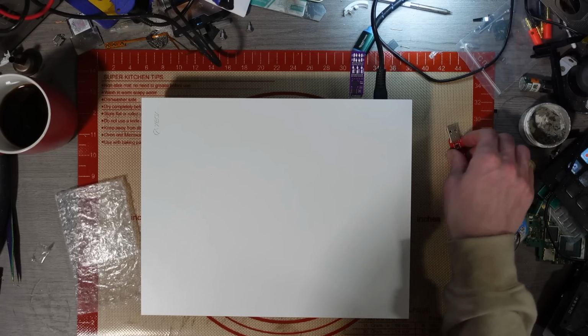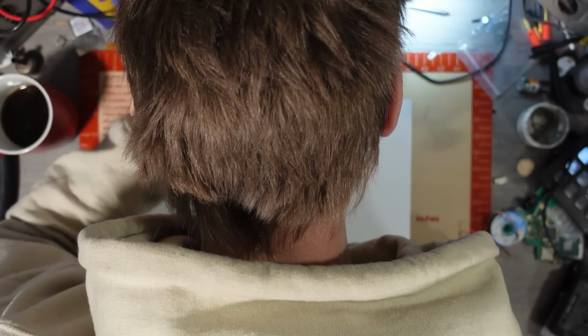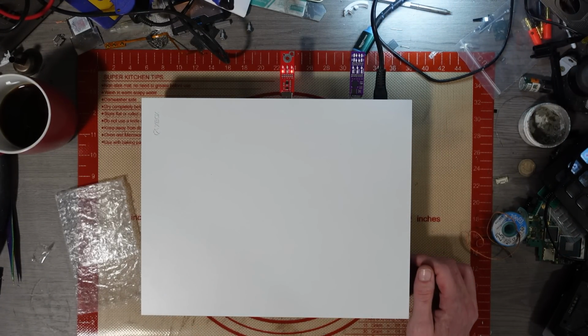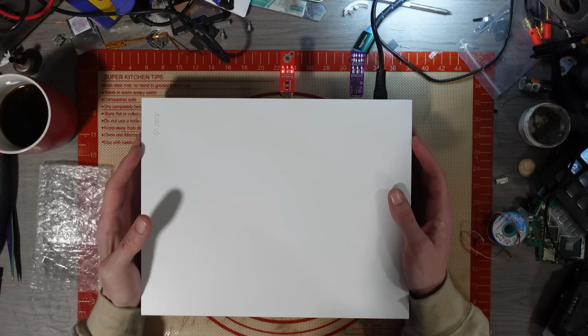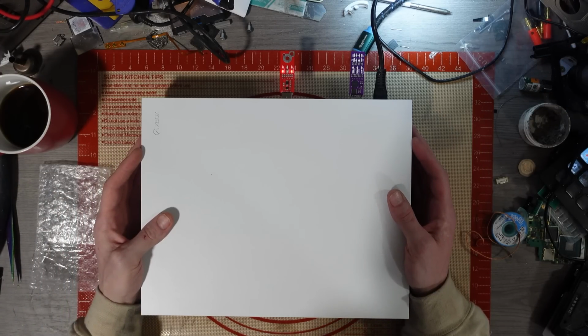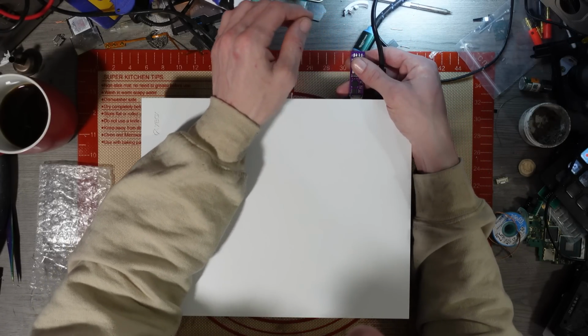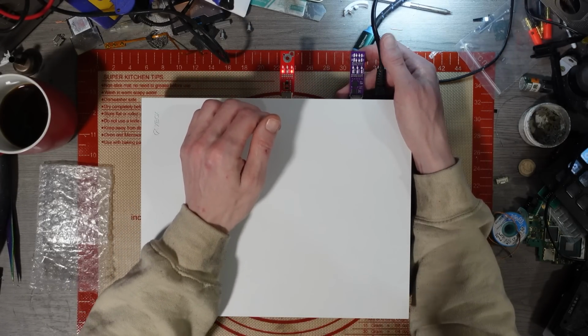Well, okay, so the console turns on. Let's plug in USB. Okay, this is overheating as well. This console's overheating as well. It looks like it hasn't been put back together fully, so I'm not going to leave it on too long. Yeah, it's just shut down on me. So it looks like we've got absolutely no data coming through the HDMI at all.